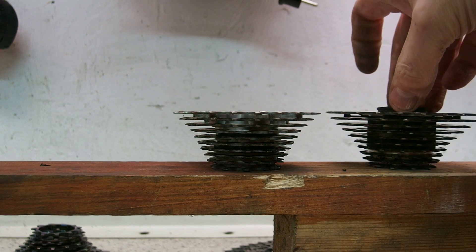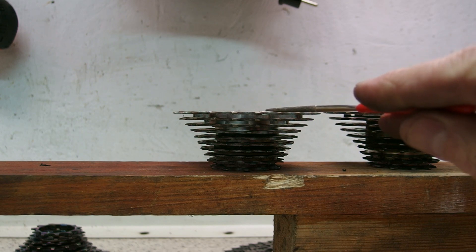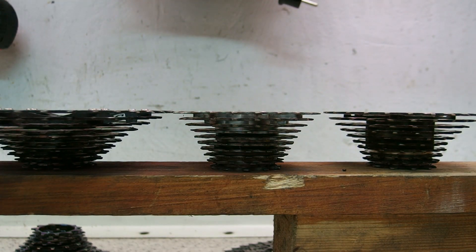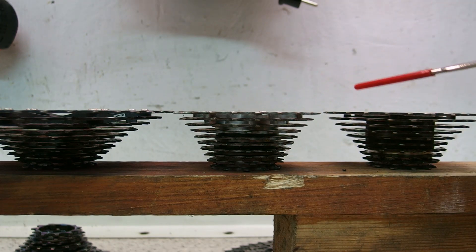Let's compare our Ultegra with this 11-25 Shimano Tiagra 10 speed. As you can see from the picture, the largest cog on the Tiagra is slightly more outward than on the Ultegra. However that's not really an issue because these two cassettes are perfectly compatible with one another — they are from the same system after all. What's going to happen if you put a 10 speed Shimano SLX 11-36 over there? The largest cog is slightly outward, but we can establish that all three cassettes are compatible, as the difference doesn't impact shifting in any meaningful way.